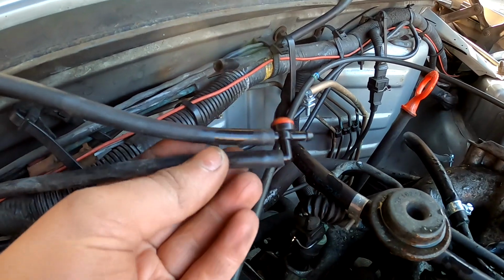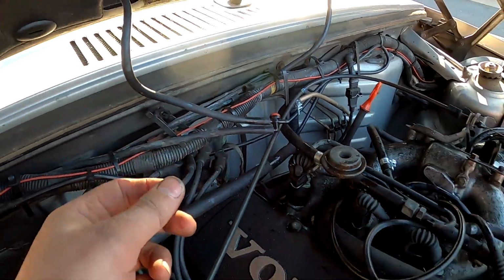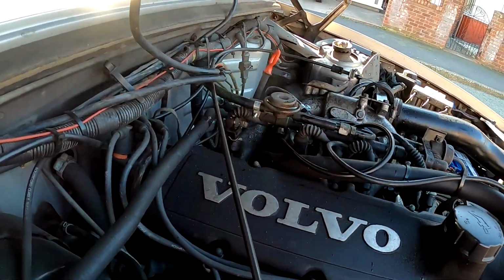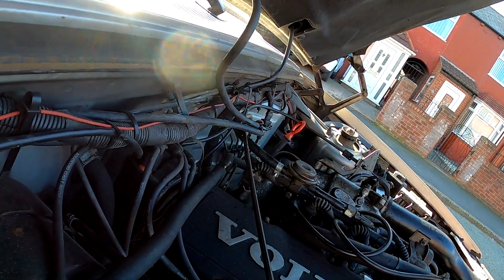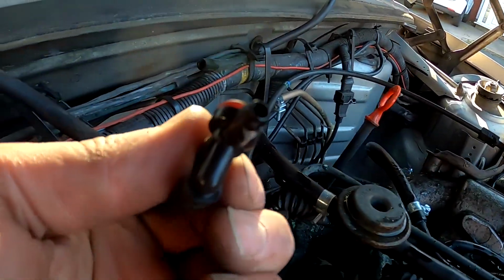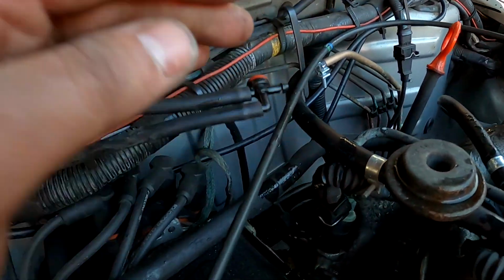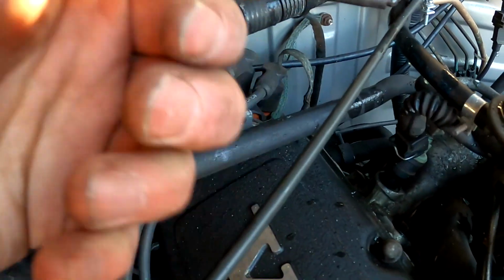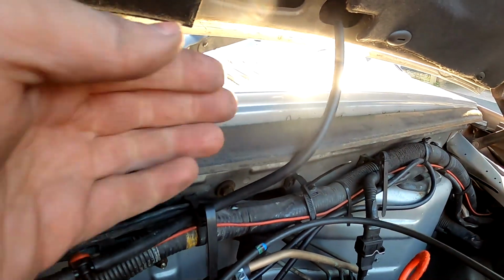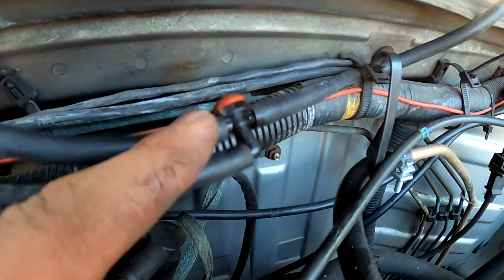So let's pull the other one off. Right, so I plugged this lower pipe back here, and obviously this goes up to the first washer jet. So let's see what we've got on that front. Nothing going to the washer jet, but it's forcing it out of that end. So plug this one back in. Right, so with everything put back in again, we've got this side spitting about the nozzle and this doing absolutely nothing. So we know that that valve's free because it's blowing through okay.